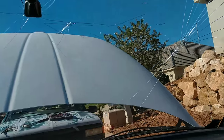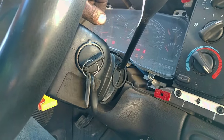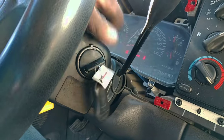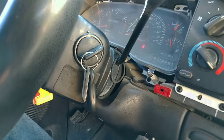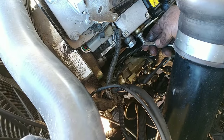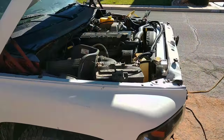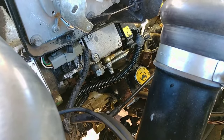You're gonna need to cycle the fuel a little bit. Turn it about like that, give it about three seconds, turn it off, turn it back on again, bump it. Don't try to start it — just bump it. This will engage the fuel pump and hopefully build up some fuel pressure. This truck actually bleeds off its own air, but it is helpful to go in there and press the Schrader valve right there every once in a while.